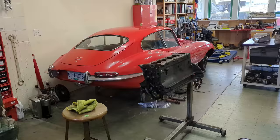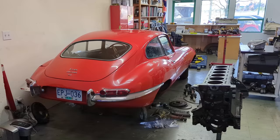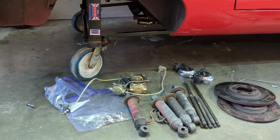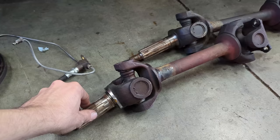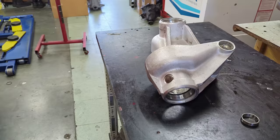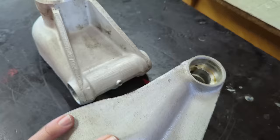Really happy to have the engine completely disassembled. Switching gears a bit to show my side project — this is the junk E-type. It's had over 8,000 miles and I had a bad differential noise, so it's time for a rear-end rebuild. There's a cart in place of the rear end. Here are the main drive shafts and the splines — I took the hubs off, replacing those. I have the hub carrier units, the uprights. The wheel bearings look like a perfect race — just a bit of grease — so I'm retaining those. But some smaller bearings around the pivot point had moisture in them — the race is completely pitted out, so I'll be replacing those.